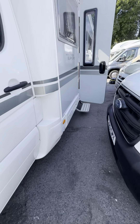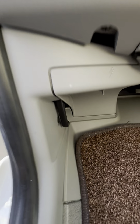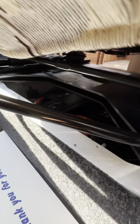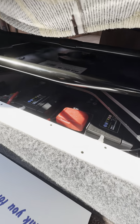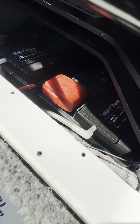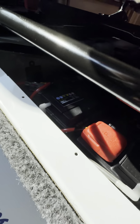On the front near side, if I just open up this passenger door, we've got your bonnet release handle just inside there. A load of fuses and relays underneath this little cover here as well. The customer has opted for a twin leisure battery setup — you can just about see twin batteries down there. These are your leisure batteries. I've done it properly so both batteries have breather valves going down to the outlet underneath, and a decent thickness of cable running across between the batteries.